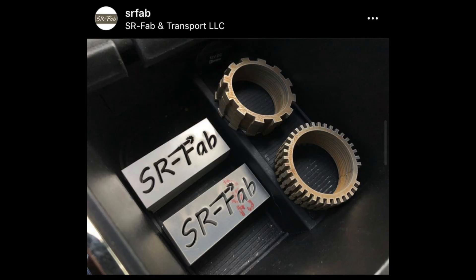So what does that mean for me? I will have to run an individual cam signal and an individual crank signal. Luckily, I have a local buddy you guys have seen before — SR Fab. I used his oversized washers for the head, and luckily he also makes an adapter so I can run hall sensors. I'll put pictures up on screen. He makes specific brackets that work with hall sensors for both the stock 7M cam gears and the stock 7M crank, so you can run individual crank and cam signals. That's the route I am going with.